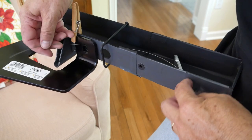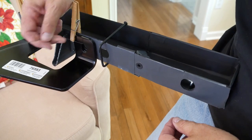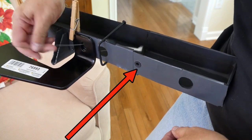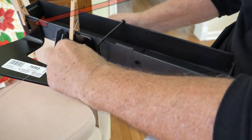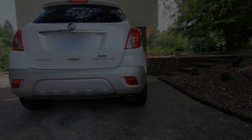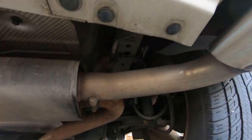There's just a couple of issues with using this access hole. Number one, I don't know how far up inside the rail this plug goes, and it might block me. And two, I'd have to rig a way to make the pull wire longer to reach the rear mounting hole. This is a perfect application to use my borescope for some investigative work.